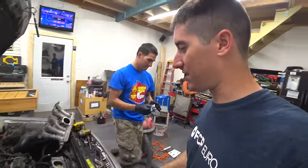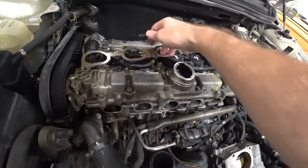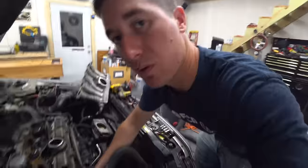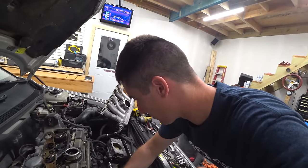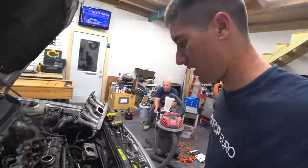You can hear it — so we don't have to drop the oil pan. That is a huge plus because we were already really far into this job. We're taking off that intake bolt right there. We can put on our new gasket now. We're going to use a little brake clean on a rag to make sure this mating surface is exceptionally clean, and then throw everything back together. It's go time.